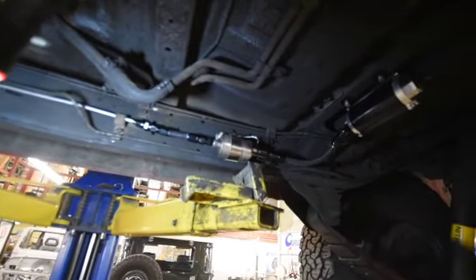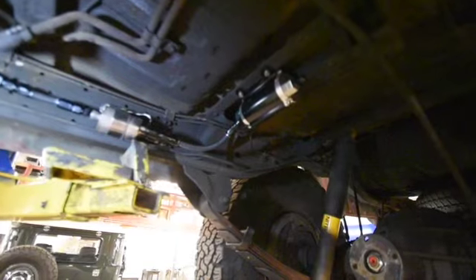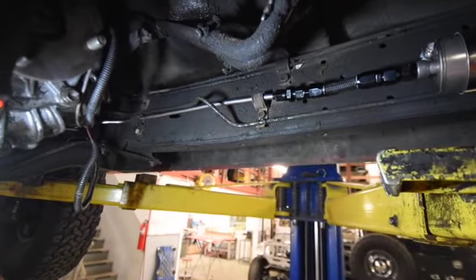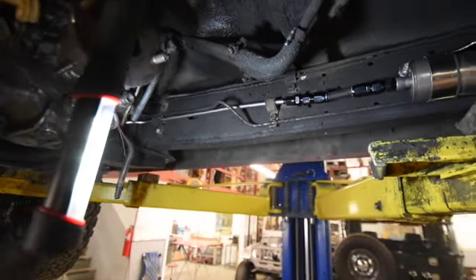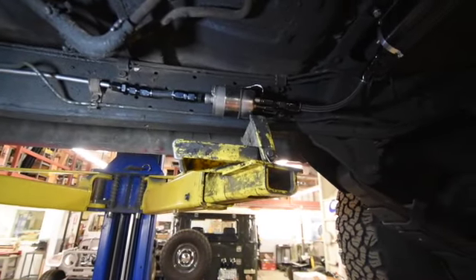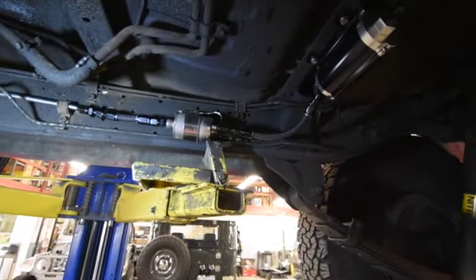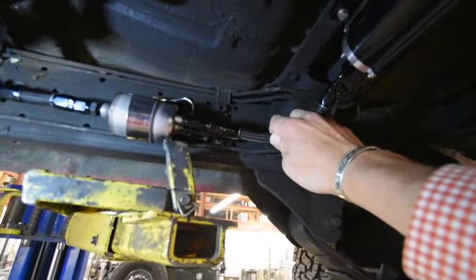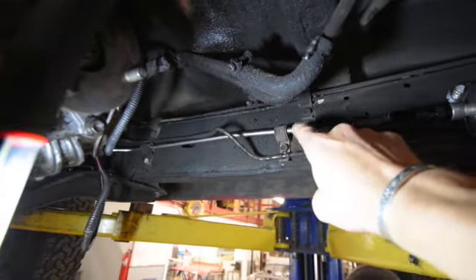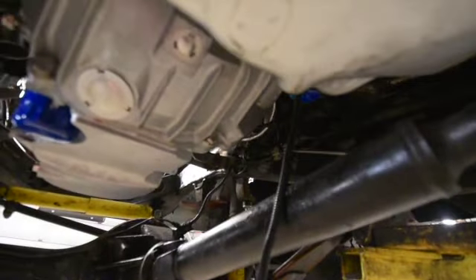I'm underneath the Land Cruiser, and what I'm showing you now is a fuel filter and the new fuel pump located on the right side of the frame rail. We've run brand new stainless steel fuel line all the way to the front. The reason being is that we need a larger volume of fuel for this engine compared to the straight-six stock engine that was in there before. That's causing us to redesign some of the fuel system, and we're using flexible braided line where we have these sweeps, and compression fittings in order to get up to the front of the engine.